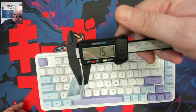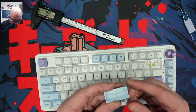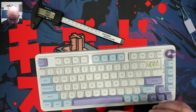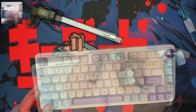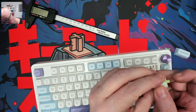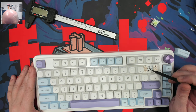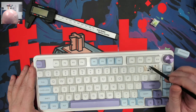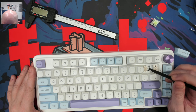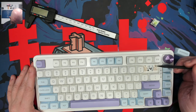All right, so these keycaps are 1.5 millimeters in thickness, and because that just looks like the shine-through plastic, it may be a combination of the two. We have that nice Mint Mambo linear switch, quite light. Then taking a look at the PCB, we do have hi-fi layers, which is the PET layer with IXPE above that. And it is north-facing with 5 pins.